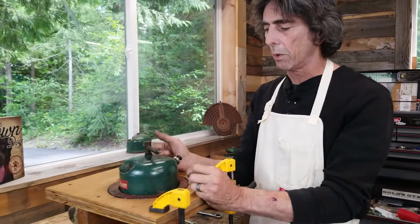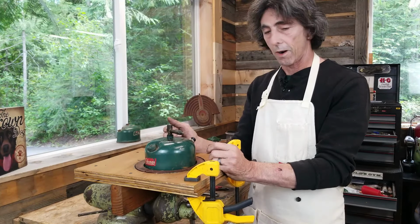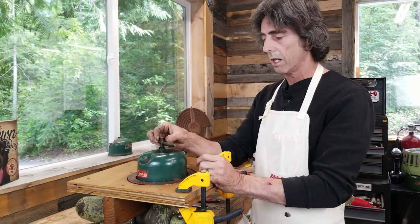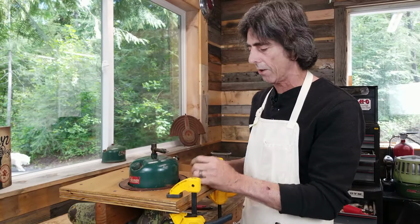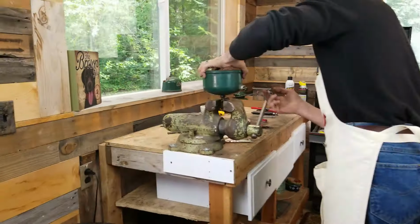Okay, so the next thing we want to do is, after doing that test, we can remove the valve. There are a few ways to do this. This is a 9/16" fitting, and you can put a socket over this. That way you don't bend things out of shape. You can put a socket and remove it right now, but the easiest way I've found is to put it upside down in your bench vise and turn the font around the valve. And I've always done that, so I'll just do that right now.